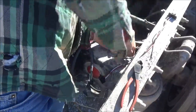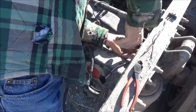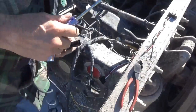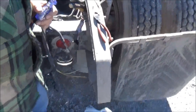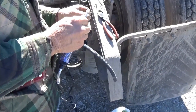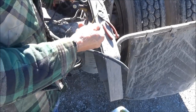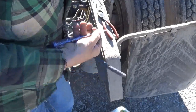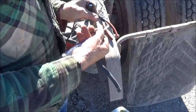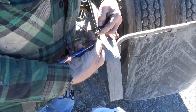I'm trying to bust through the rust on this little pin that's welded on that holds wiring harnesses in place. I apologize if I'm not getting all of this on the camera — I really can't see the viewfinder. I expect it to be this black one here. I can't find my test light, so I grabbed a new one. It hasn't been used yet. It works — the light's coming on. Here's my tail light. And this white one should be the ground. Yep, I'm getting the light on again, so that ground is good. We've got our colors figured out.